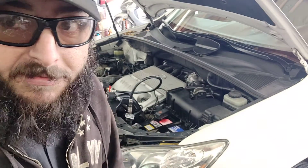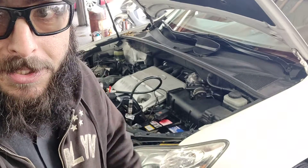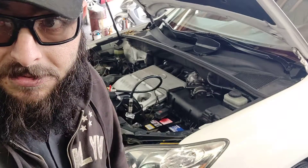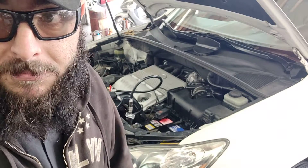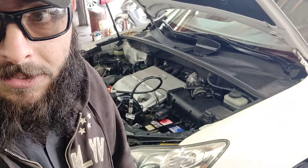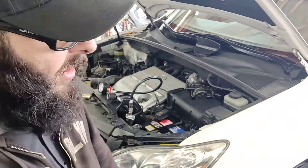I don't like pumping and pumping and pumping. It's just a lot simpler to plug it into some shop air, use the adjuster to get it up to 15 psi or whatever your cooling system is rated for, close the valve, disconnect the airline, and then watch the gauge to see if it drops.